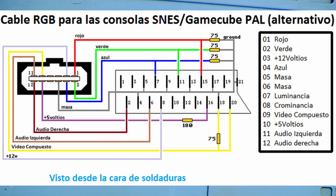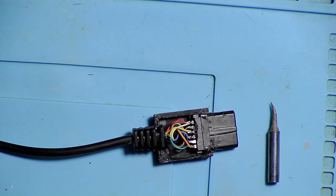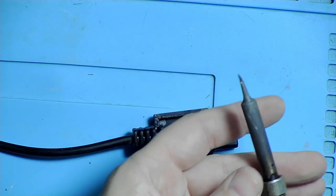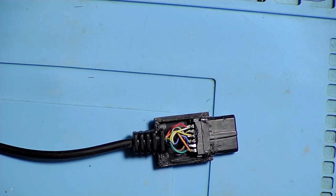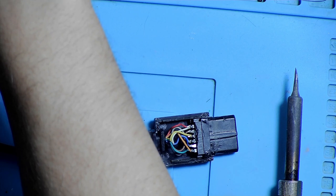As you can see from the schematic we just need to move the cable. There are different setups for the cable — one with capacitors, one with resistors — and you need to reference both grounds in the connector. Nothing special really, but there are different setups for different cables. I'll be doing a series on how to make your own cables very soon — making very high quality RGB cables instead of buying these pre-made ones, because as you can see there's no shielding whatsoever. On the Sega consoles especially you can see the ripple from the power lines bleeding through the image.